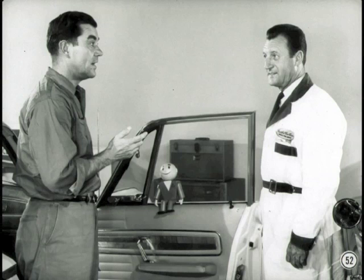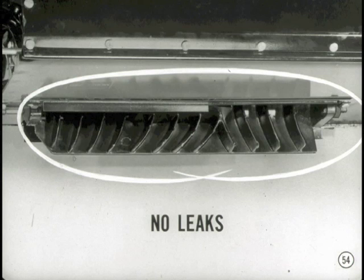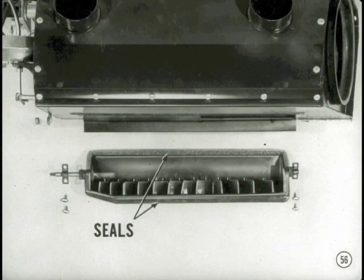But supposing the cold air leak persists even after you've made the actuator linkage adjustment — what then? It's possible that the cold air is leaking past the deflector seal. You can check the seal by removing the blower and holding a light inside the heater housing. Look for light leaking out past the seal when the deflector's in the heat position. There should be no leaks all along the full length of the deflector seals. However, don't be concerned if a little light shines through beyond the ends of the seals — just be sure you find and correct any big leaks that will cut down heater output. While you're checking that area, be sure the round seal at each end of the deflector shaft is doing its job too. A leak at either of these seals could aim a jet of cold air right down on somebody's feet.